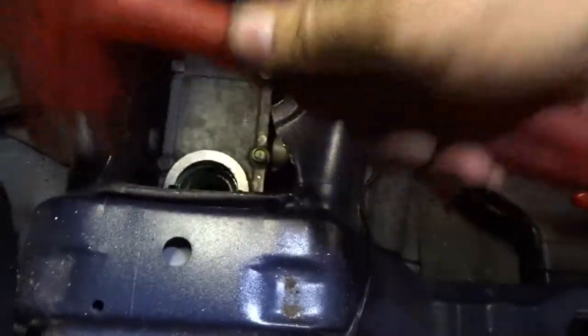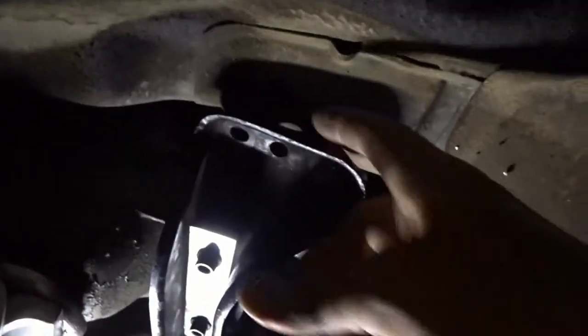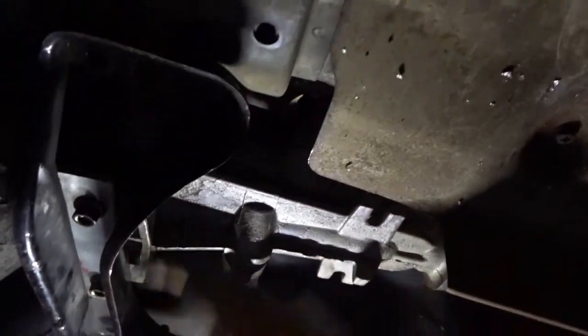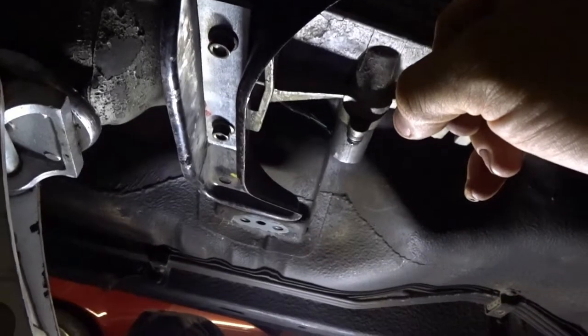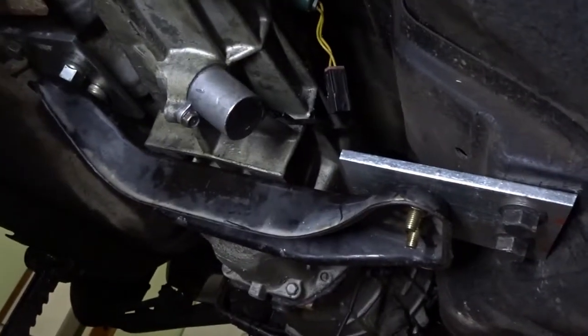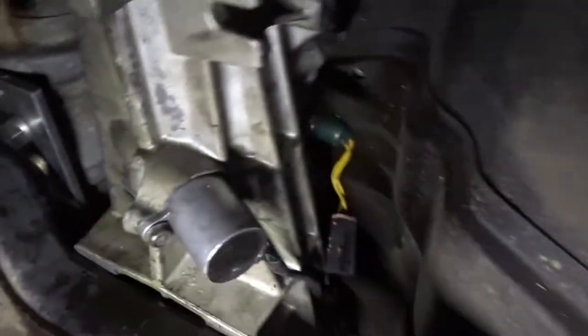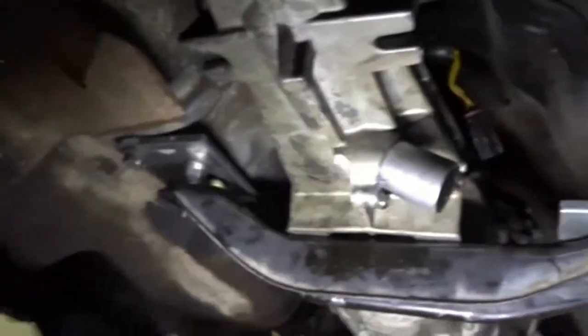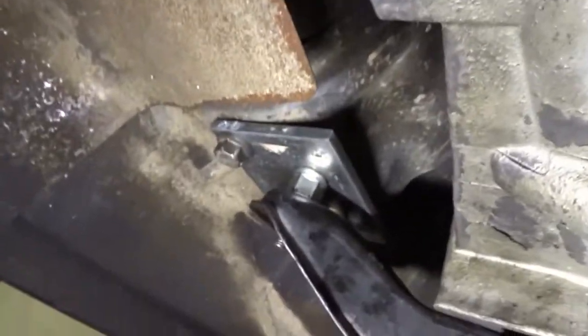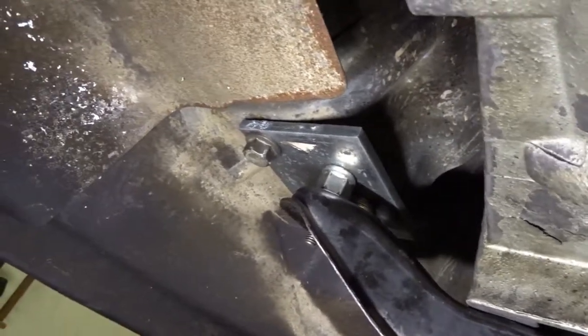Needs a little bit more. Perfect. I reckon we could just go straight from this mount to the chassis and it'll be almost perfect. Check out these sweet engineered mounts — that's an S13 gearbox crossmember with a bit of flat bar cut and holes drilled in it so it can bolt straight to the gearbox. Flat bar there, another bit over there with a wheel nut that's been shaved down a little bit and some washers to space it out. We'll see how that goes, eh?